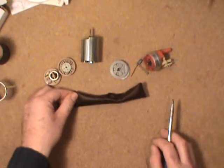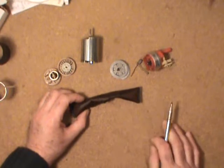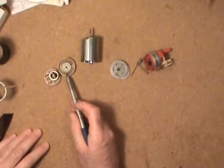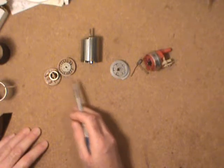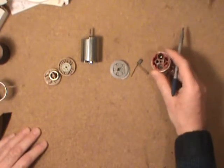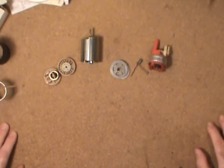To sum it up: you've got the filter sock that takes most of the crud — there's a lot of stuff in gas tanks, especially steel gas tanks over the years: scale, rust, contaminants. That filters most of that out. Most cars with fuel injection have a sock of some kind in there as a pre-filter. Then the low pressure transfer pump — motor spinning the impeller — transfers fuel at a lower pressure into the high pressure pump, which increases the pressure to the fuel line pressure needed to run the injectors. That gives you and me a good idea of what's going on inside that gas tank if you've got fuel injection — there's an electric motor in there pumping away to keep things running.